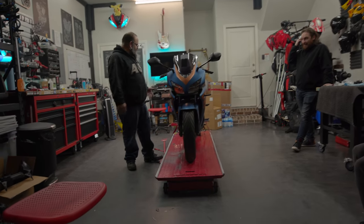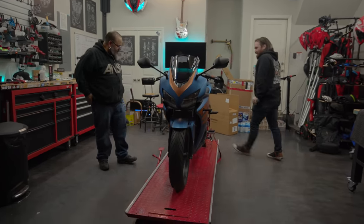That's what happens when you put this big fully open exhaust system on it. Okie dokie. Last we have to do before we take this thing for its maiden voyage: double check the chain tension, double check the tire pressures, and bomb it down the street. Sounds like a good time. What do you think? Yeah, but unfortunately...